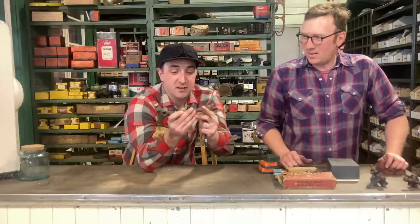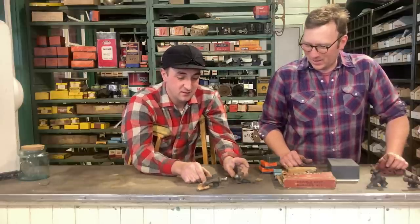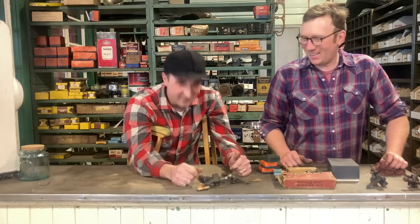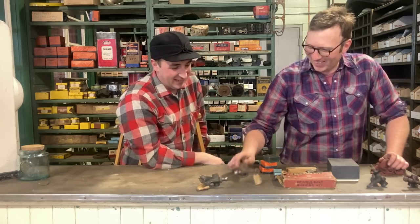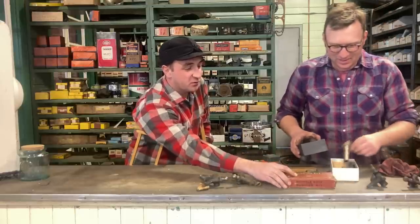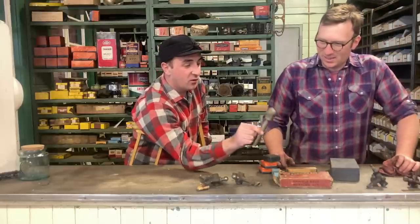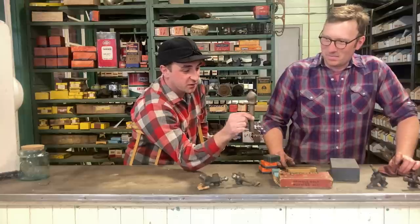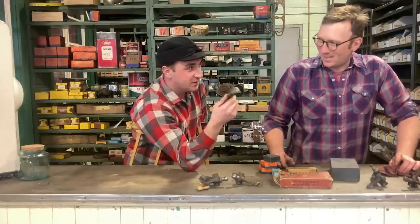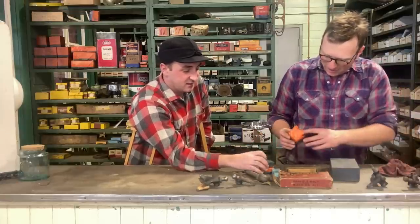They got brand new bushings in them. So that's pre-done right from the factory. Never had a nut on it. So it should just be a plug-and-play type situation. Yeah, we'll add a little bit of anti-seize on them. So that the next guy doesn't have trouble. More than likely might be me. And then we have kingpins that we bought off Terry. Some nice new old replacement stock ones. Then we also got these beautiful NOS factory Ford ones here in the box for a later date. A lone original Ford one for 35-36 Ford, which is neat. Till we find the mate. Three outer wheel bearings, NOS. It's always nice to get a few things.